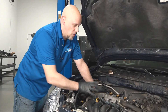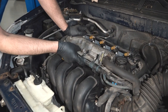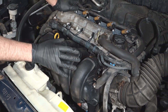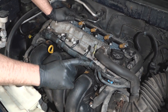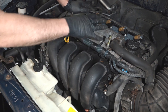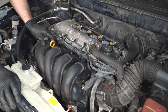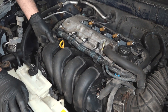A very common problem on these Toyota Matrixes is the intake itself and the gasket. The intake could warp and cause the gasket not to seal properly, and that could be our issue. One way to test this is to run the engine and spray some carburetor cleaner all along the areas where the intake meets the head. If you see the engine stumbling or if it changes the way the engine runs, most likely you have an intake leak and the gasket will need to be replaced, or possibly the intake itself.